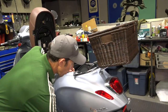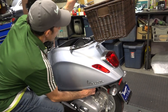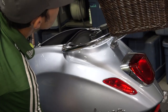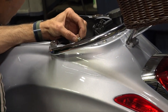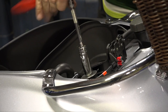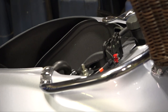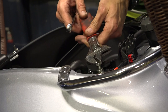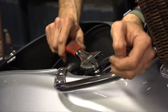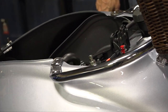Take the complete coil-over shock assembly and fish it back up through the hole in your frame. Take the rubber spacers for the top — slightly smaller diameter — then your pair of washers: the large flat washer and then the split washer, and last the nut. Start threading the nut on straight — these have a tendency to cross-thread. With the ratchet and deep socket you can go pretty far until the shock starts rotating, then get the closed-end wrench on the nut and torque it to about 15-16 foot-pounds, fully compressed on the washer.